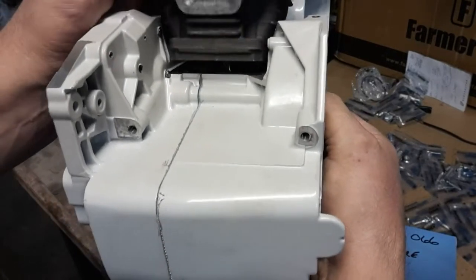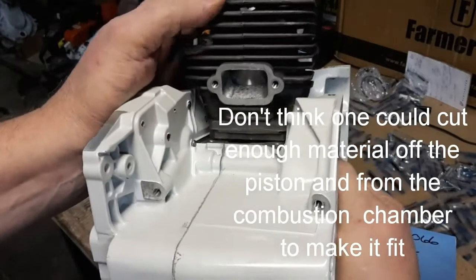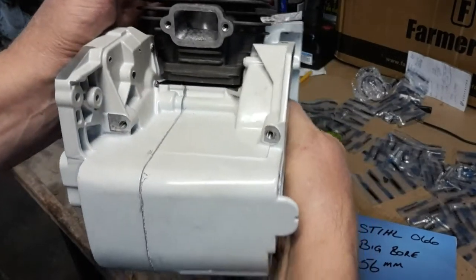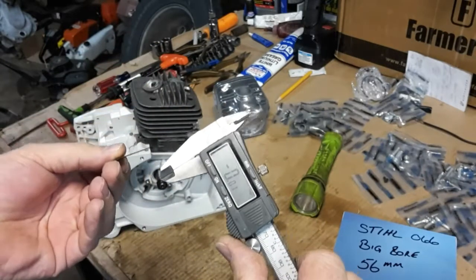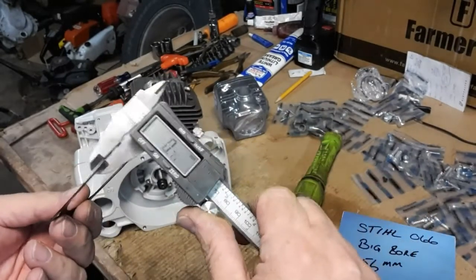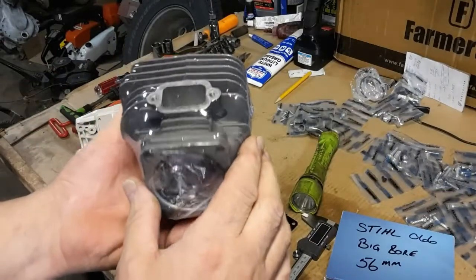Look at the gap — that's a quarter inch. As I turn the piston up, there's no way that the little metal shim gasket they supply is going to take care of that kind of a gap. This is the little metal shim gasket — .65 before it's crushed. So I've done all that port work on that big bore cylinder for nothing. Now it looks like I'm going to be using the standard cylinder, the stock cylinder.